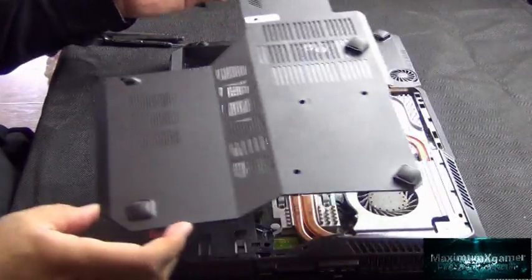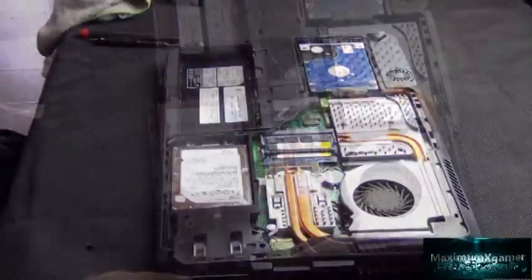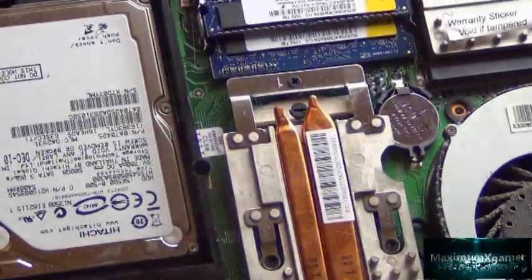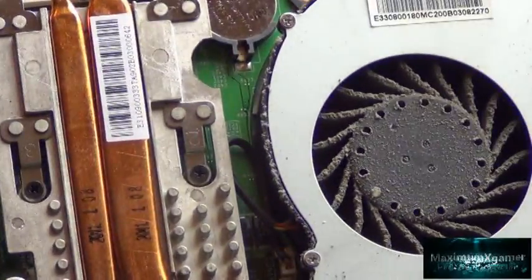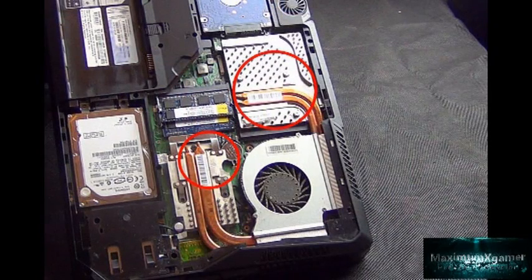As you can see, there's quite a build-up of wet dust surrounding the fan. There are three areas which need to be separated in order to properly clean the main fan and the filters surrounding it. The first area covers the chip, which is directly in front of the fan.